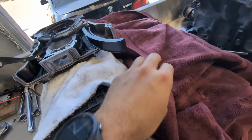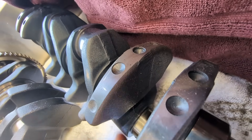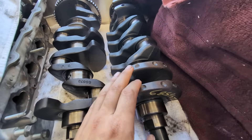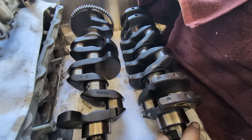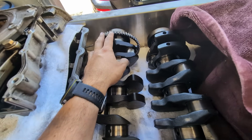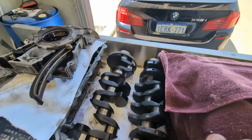This will be getting reused in my CNC ported head. Over here I have my cranks — factory crank and diesel crank. A couple of things to point out: the diesel crank is fully forged. You can see the big fat seam from the forge die, versus the skinny line from the casting process on the factory crank. So this is a much stronger crankshaft. It's also fully counter-weighted, which means it can rev a lot higher. This crankshaft weighs nearly twice as much but the counter-weighting will allow it to get its RPM up smoother.